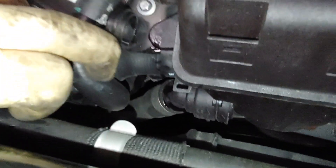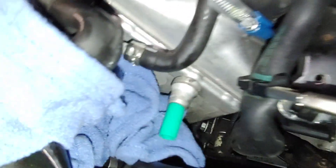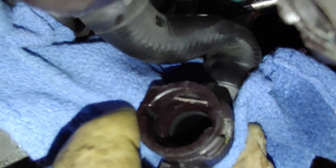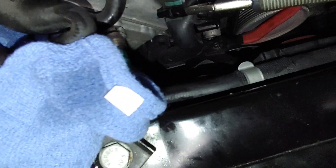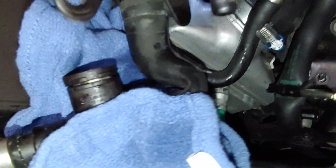I got that out of the way, pushed off to the side. Now remember — when you pick this up, it's going to drain some fluid down. When you initially take this off there might not be anything coming out, but when you pick it up like this, that fluid's going to drain back down and start trying to pour out. Make sure you cap that, and also be careful — you can see there's some fluid there that's going to start pouring out. If you have something to cap it, great; if not, make sure you have some rags. The pump is now loose.